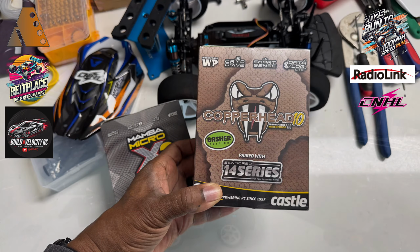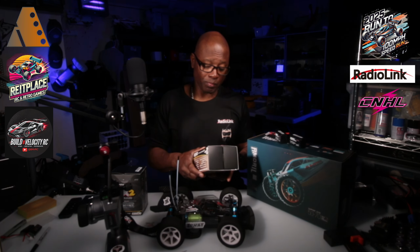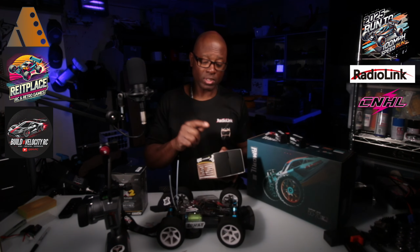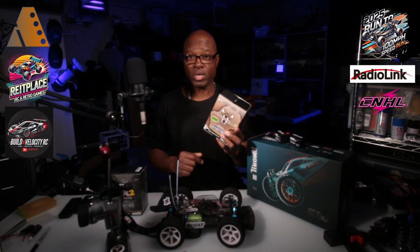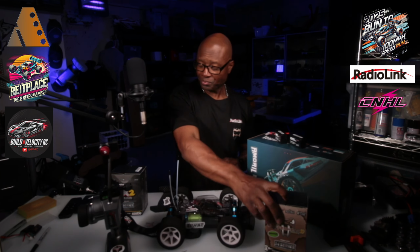I wasn't going to go Castle. I was going to do Hobby Wing, but I said to have what may be a better chance, because most of the people that I see making it to that 100 miles an hour are running Castle ESCs. I said, let me go ahead and just follow their lead. I'll go ahead and go with Castle. So this is the 1406 1500 kV set with a Copperhead 10 ESC.